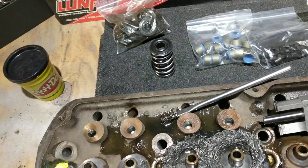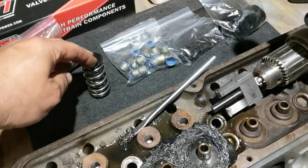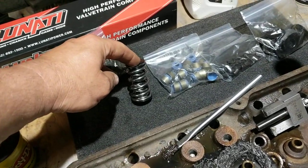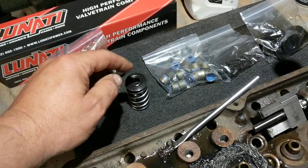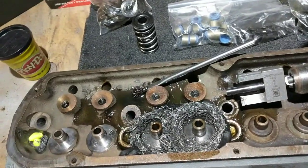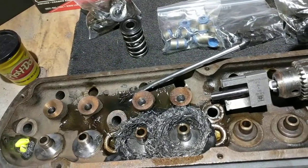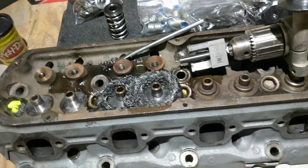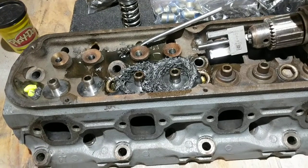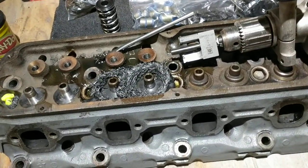It's a little insurance for me because I tend to overthink things, but I've broken the outer spring before and were it not for the inner spring, the valve would have dropped right into the combustion chamber, ruined the head, and probably ruined the short block too. As much as I plan to take this to the track, I figured I better have that peace of mind.